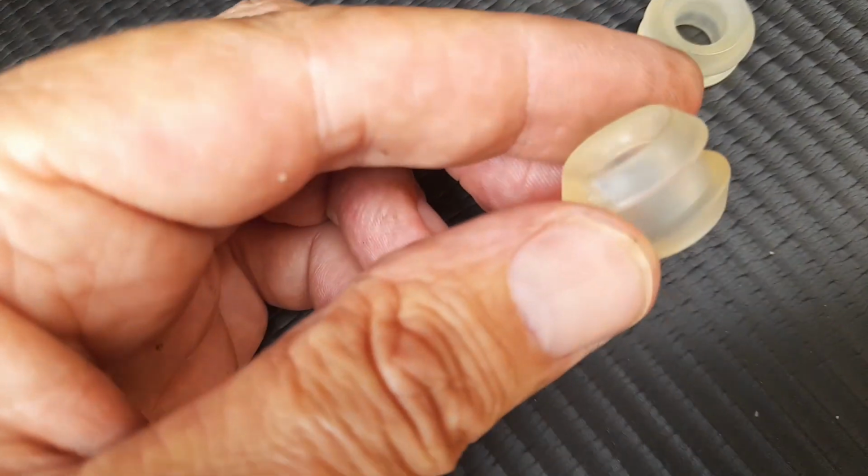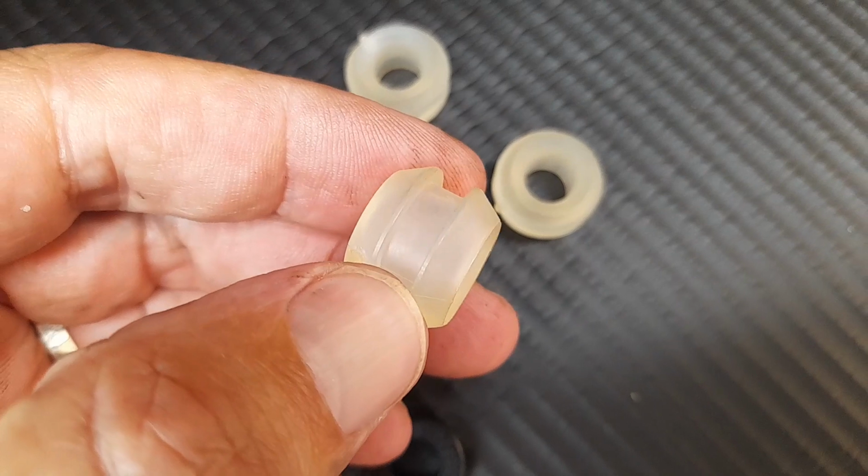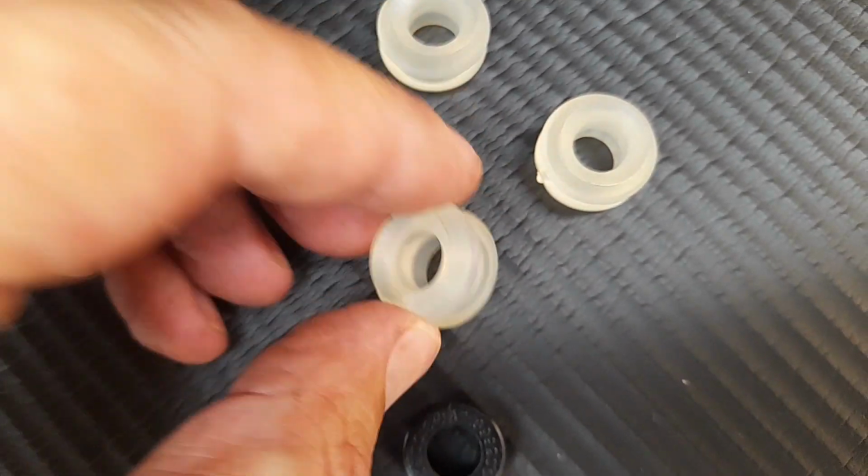And what happens is these basically wear, where the gear selector arm bushes end up coming off, and you can't select gear or the van gets stuck in gear.